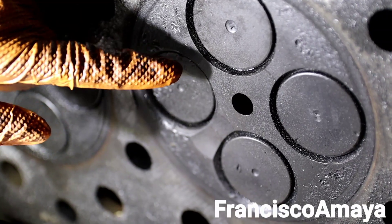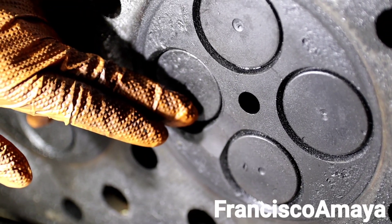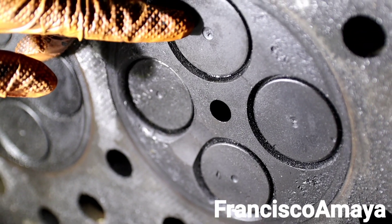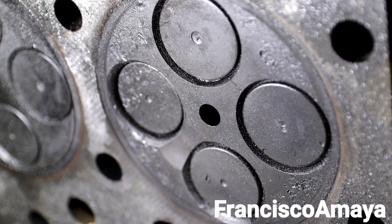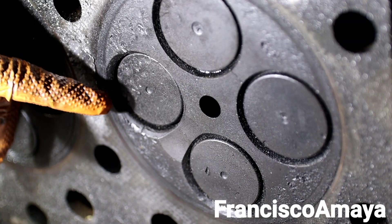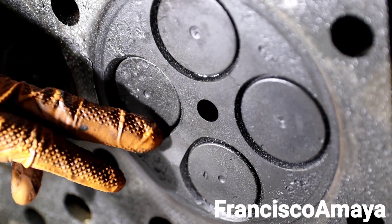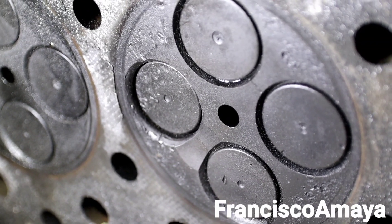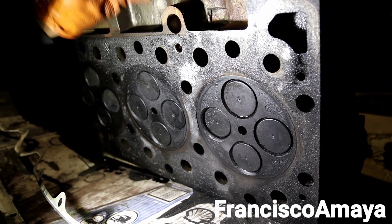So these three cracks in total. If this valve was going to have this problem and you didn't take care of it on time, the other ones will suffer the same problem until you get all three valves with the same issue. There is no way to fix this — there is no way to repair this problem because the cylinder head is already cracked. There is no way to weld and repair it. You have to buy a brand new cylinder head, and this one is not accepted as a core because the damage makes it impossible to repair.